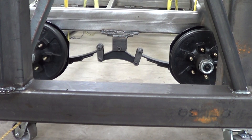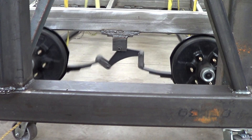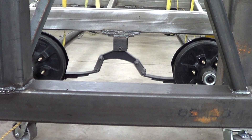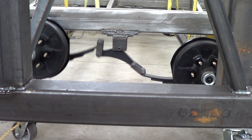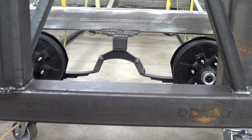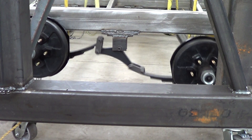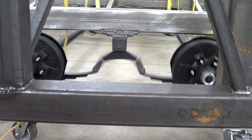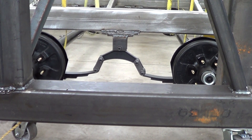Overall, what you want to do is not bounce all four wheels in the air at the same time. If you do intend to do that, then you probably want to carry a couple of floor jacks to make sure you get things back in the right place. You probably don't want to use bottle jacks and crowbars, because when things do pop back in the right place, they can move pretty fast and with a lot of force — and then you'll have bottle jacks and crowbars flying all over the place and smacking you in the head.